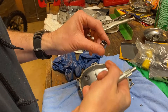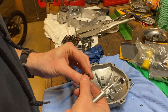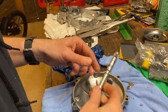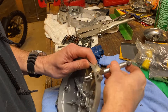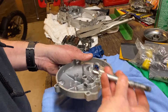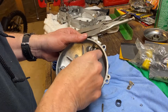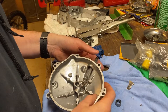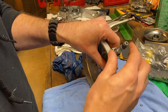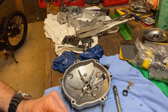Here's the aftermath. Here's the bearing — you can see it's missing a bunch of rollers; some of them I probably knocked out as I was doing this. The bearing only goes on from one side. Luckily I saved the shaft because you can't get these. With the case broken, it goes in and out pretty easily. The question becomes, with a good case, how the heck do you put it back together? I don't know — do you have to have some kind of crazy bearing driver to drive this in from the top?